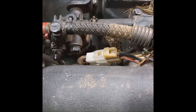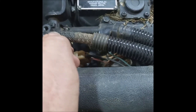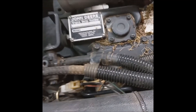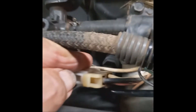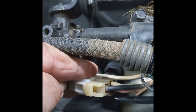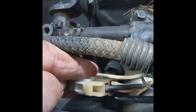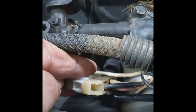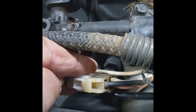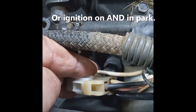You can also test the wires coming from the harness. When you turn your ignition switch on, the white wire into this connector should have battery voltage on it for about three seconds. The red wire is the hold-in wire and should have voltage continuously when the ignition switch is on and the seat switch is made.